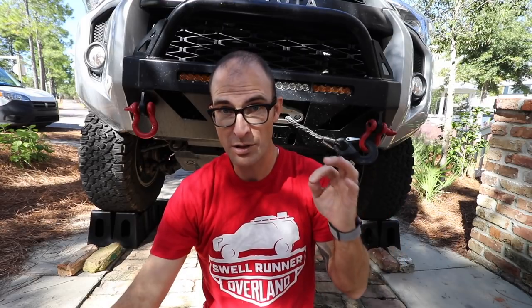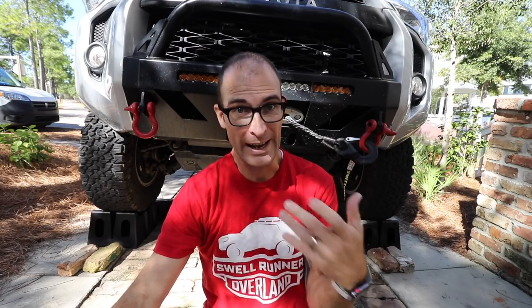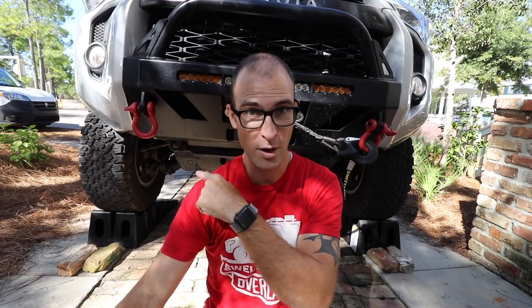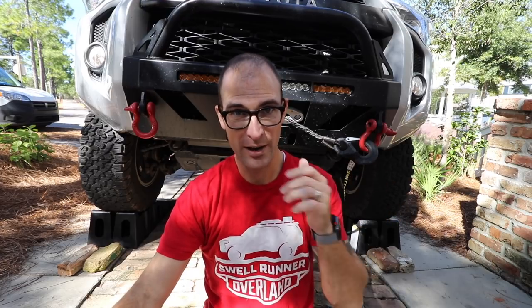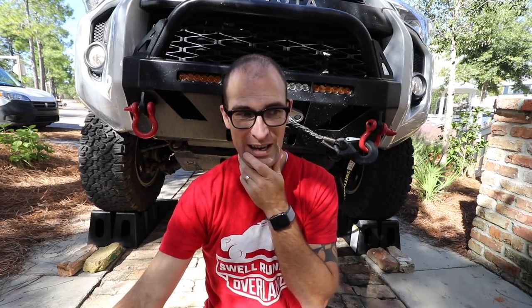There's a lot of quality options out there but I chose RCI because I know several people that are running them and are happy with them. I chose aluminum because I've become increasingly conscious of the weight of the vehicle as I add things to it, plus I didn't really feel like I needed the rigid protection that steel offers. This set includes a skid plate that replaces the factory front skid on this trail model, adds a transmission skid, and a transfer case skid. The trail model also already comes with a fuel tank skid, so I don't see needing anything extra there.